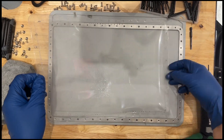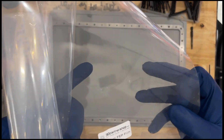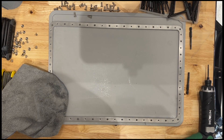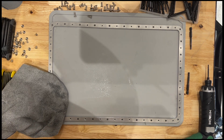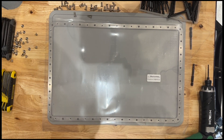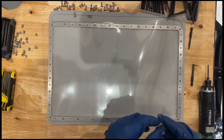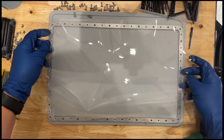The top frame has come off and the FEP is between them. I'm using the microfiber cloth, wiping it off really well to make sure there's no residue between it and the FEP — because no leaks. This is pretty standard for everything you're going to do with all the printers. The FEP is peeling off nice and pretty. I'm trying to show you where the puncture is. That goes to the trash can, and we'll start laying down the new FEP. A lot of FEPs come with a top and a bottom protective layer, so make sure you are peeling those away. The side with the sticker is the FEP side, so I want to make sure I get that laid down correctly.